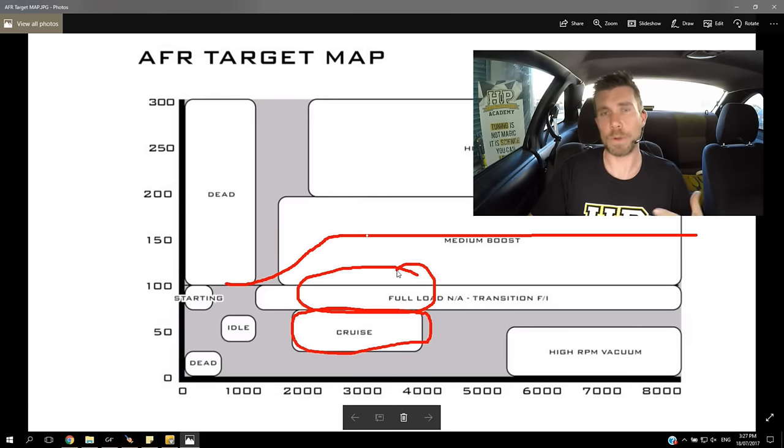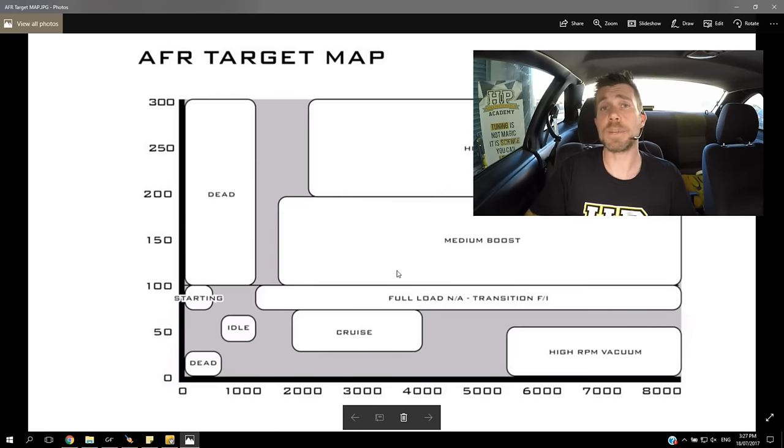So it's important to adjust our tuning techniques so that our air fuel ratio remains correct as we move into these regions. When we're moving into our steady state tuning process we're going to be moving up into the positive boost regions. When tuning a turbocharged car under steady state conditions, this is one of the aspects that tends to scare a lot of tuners off. The engine can end up producing quite a lot more heat than a naturally aspirated engine, particularly around the exhaust system, the turbocharger exhaust housing and the exhaust manifold itself. When we are tuning on the dyno on our mainline chassis dyno, heat management and thermal management of the car is really one of our key aspects.